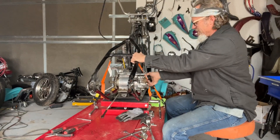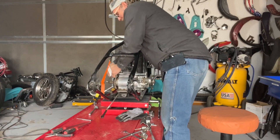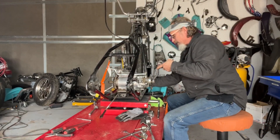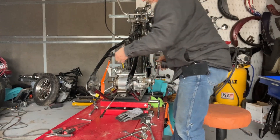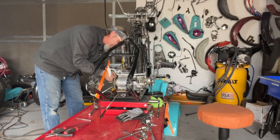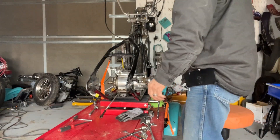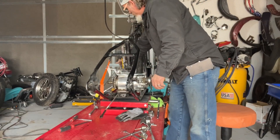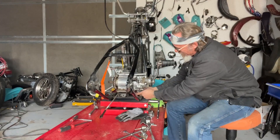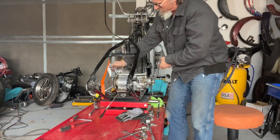We're going to take some tension off and see if she's ready to slide. I have to unhook that mousetrap — those things will eat your fingers like nobody's business, that spring has got a hell of a lot of tension on it. I forgot to take the linkage arm off — there's a cotter pin. I got the speedometer cable off too. There is one last bolt under here that's barely finger tight — good thing I decided to pull this and didn't try and run it.